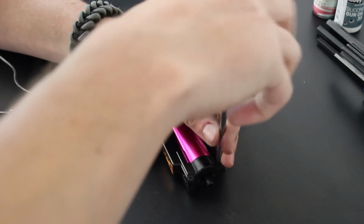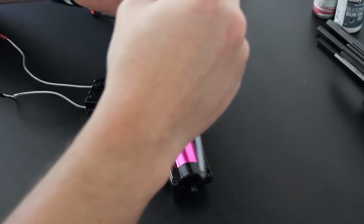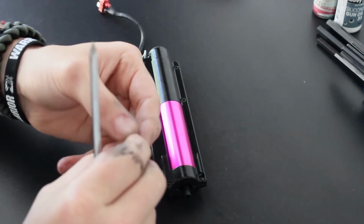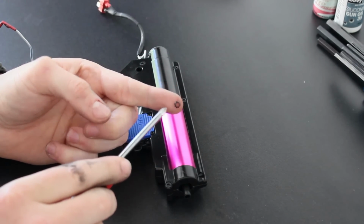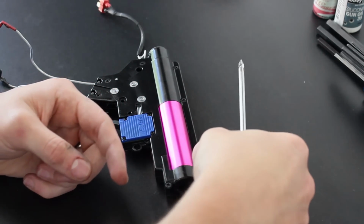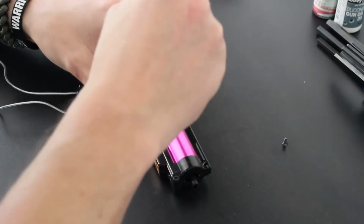Give them a nice spin. With Phillips screwdrivers, especially at this size, make sure you're using a good size screwdriver. Now on the end of these little screws, I will try and show you, are these little serrated washers. So I'll just put one on the end of my finger so that you can see it. On the end there, you've just got this very small serrated washer. And they actually sit inside where the screw comes from, so just make sure you don't lose them. Try and keep them in there if you can, and then just put all of the screws in the configuration that you take them out. So I've got that one there which associates to that hole.